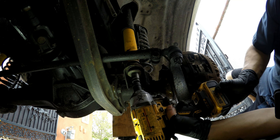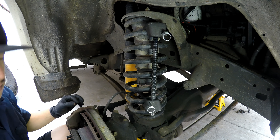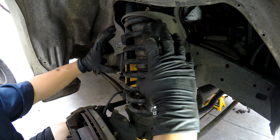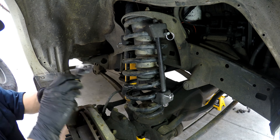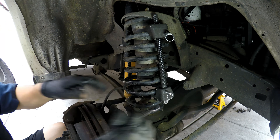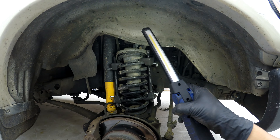19mm for the strut. Got a spring compressor. What we're going to do is get enough tension to where it's holding the spring, then we'll jack up the front of the truck and it'll separate it the rest of the way. Now we've got the middle of the spring loaded with the axle on the jack stand. We're going to go ahead and jack up the front of the truck on the frame and it's going to separate the spring.